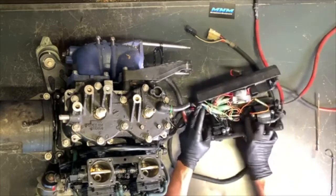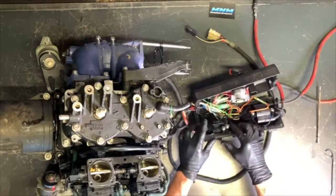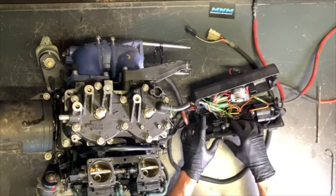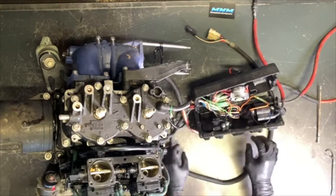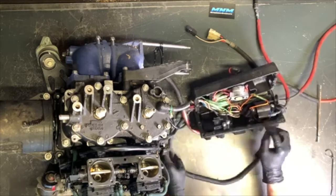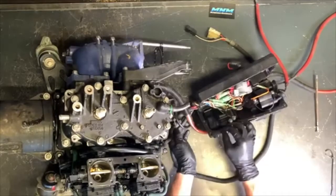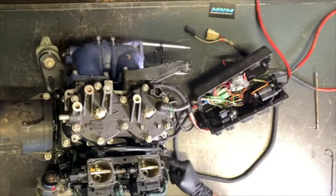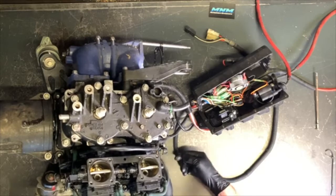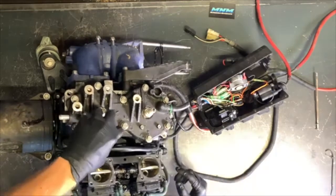Make sure that starter relay is good. We've got your ignition coils here, another relay, and your ignition control module — also called the ECM, CDI, or ECU. There are about 15 different names for it. If you need to order one, let us know — we've got a lot of those components on hand. Now what we're trying to get to is these stator wires running from your stator assembly. It looks like there's a black, green, blue, white, white-black, and brown wire — about eight different wires.